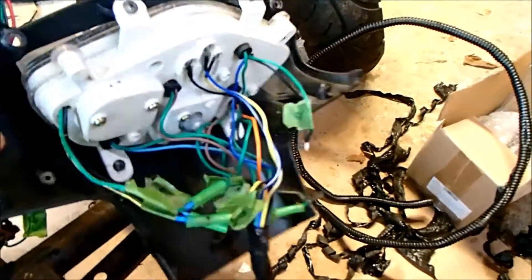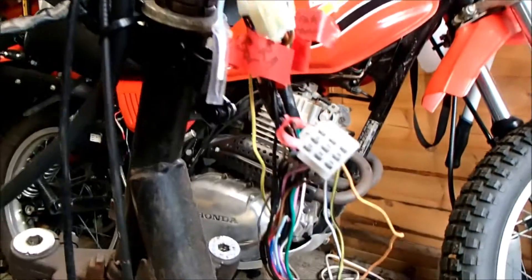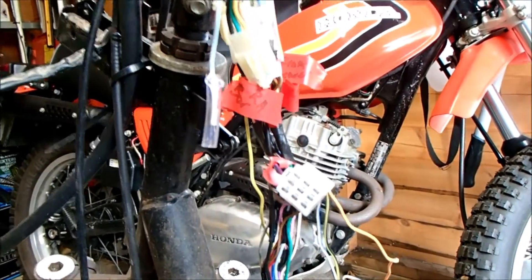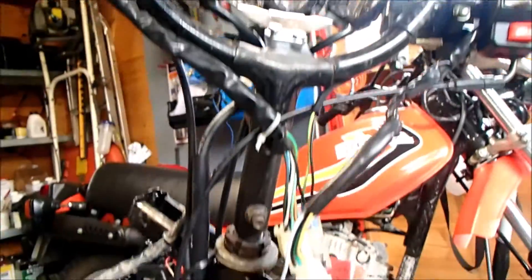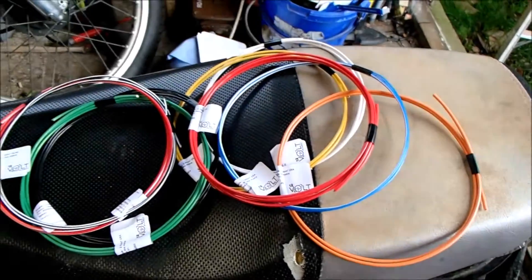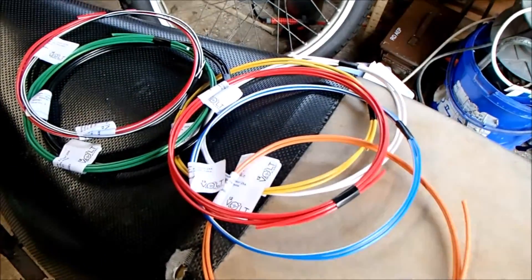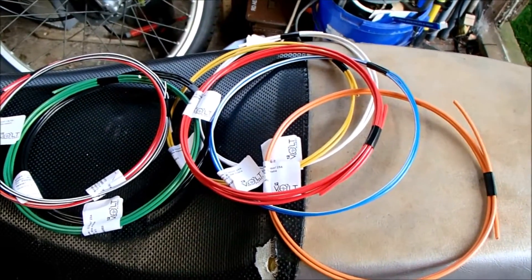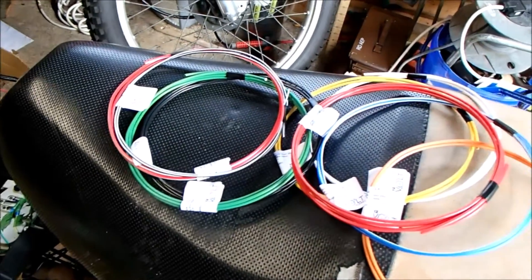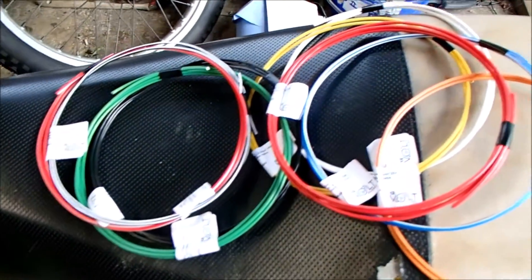I'm also pleased I didn't discard this — it's like a 'where the cables go' guide. At the front end we're attempting round one to keep the connectors where possible and change connectors where possible. For example, for the clocks I'll try and use the old clock's connectors. I found an excellent website called 12 Volt Planet — they do electrical cabling by the meter, cheaper than you'll find probably anywhere else including eBay, with a wide variety of color choices. In most cases I was able to get the same color cabling, which should help fault diagnosis in the future and make everything look more professional.